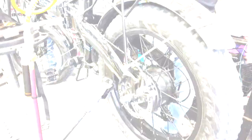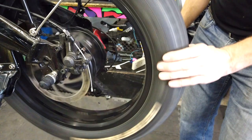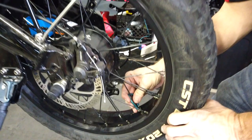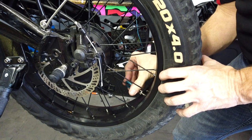We're at the bike shop now. Got the XB on the stand, getting it up there. When you're doing this process, what do you look for just to see if it's out of line? Most of the time we get to take this off and put it on the machine to make life a little easier, but since you have a special bike we have to do it a little different — kind of eyeball it. So right now I'm just tightening each spoke a half a turn.